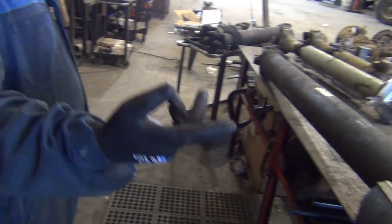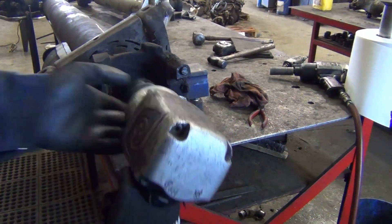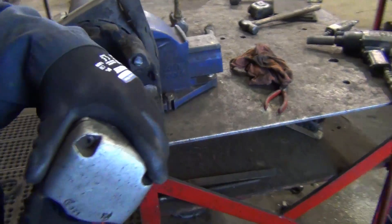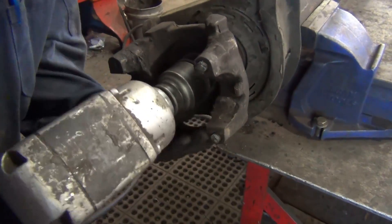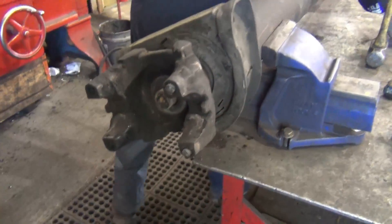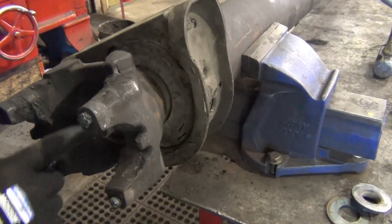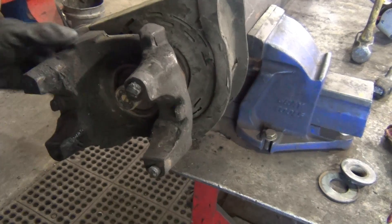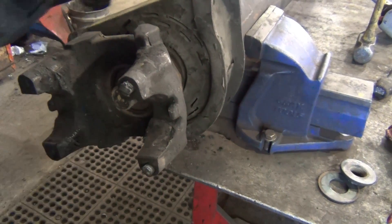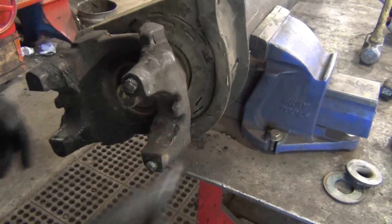So then I'm going to take this yoke off — I'm going to back the nut off this yoke here. The reason I take the nut off is I just want to make sure that this yoke is not loose on the stub. If it is loose, I either have to change at least the yoke itself, or if it's really bad, I have to change the yoke and the stub, which means cutting it out of the tube and having to do a weld on it. But in this case it feels pretty good and tight, so I think we can save that.